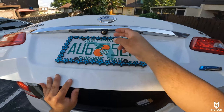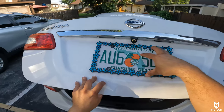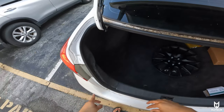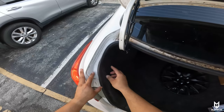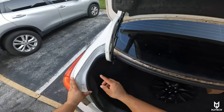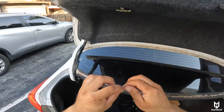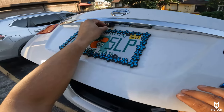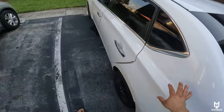This is the final outcome on the camera. I like this style because it looks more like an OEM type of camera instead of the ones that connect to the license plate. We ran the wire on the driver's side — for the 2013 specifically. The main harness that goes to the tail light: the positive is the green with black wire and the ground is completely black. There's also a trigger wire that has to be connected to the positive — that's the yellow trigger wire. I don't know why they don't do that from factory. The camera is adjustable — you loosen an allen screw on the side and move it up and down for proper adjustment.